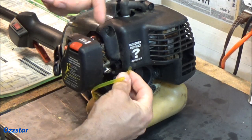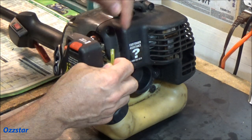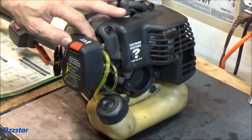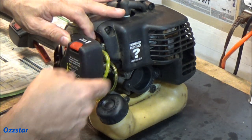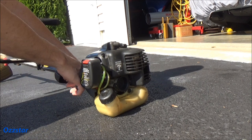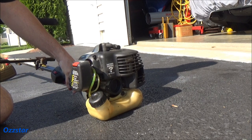So now that this is trimmed — the hose that has the filter goes down at the bottom, we just push that on. And then our return — the part that just has the little stubby at the end — goes on the top by the primer bulb. Then we'll just prime it. I'm seeing fuel get sucked up now, and the bulb is filling with fuel — I can see it flowing through both. So that's good. Time to fire it up. The carb's primed, turn this on, put this to start, pull it a couple times. Oh yeah!